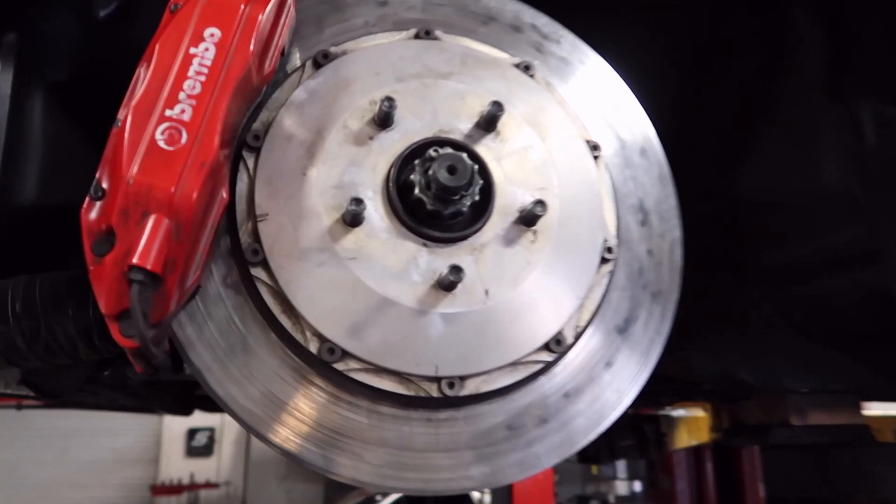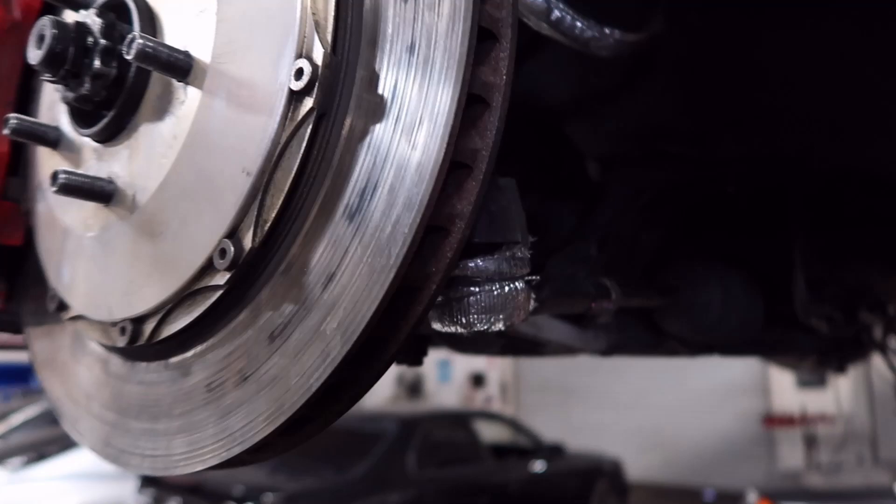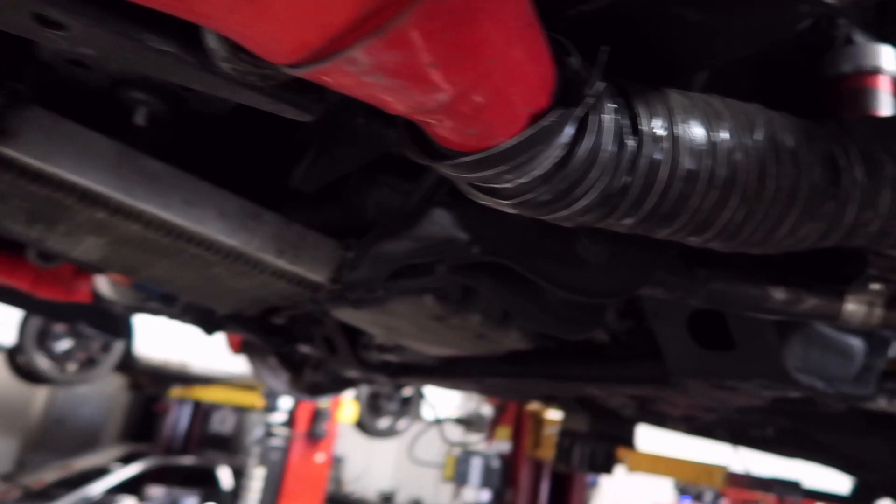So we got the Brembo F50s in the front — they're 355-32 I think, and they're probably being turned a little. It's got the stock uppers in here right now. It's got the Nismo Ohlins coilovers with sub-tank. The ducting here is getting a little destroyed. It's got these brake ducts that a lot of people ask me about. Adjustable tension rods.